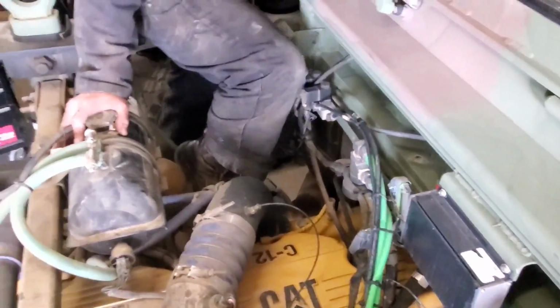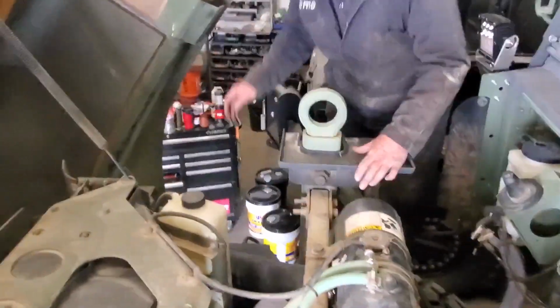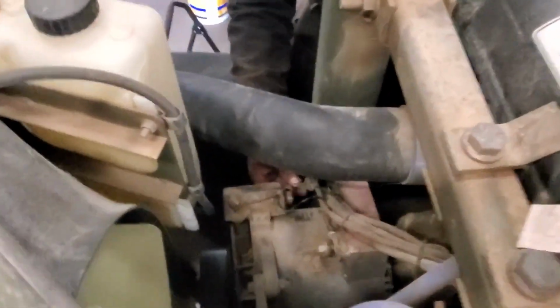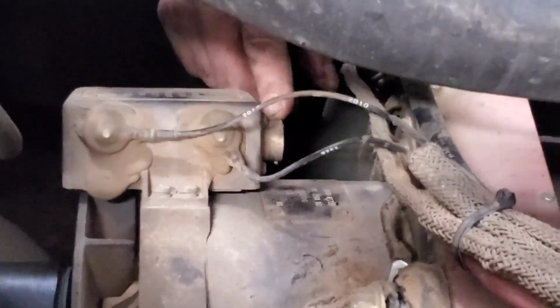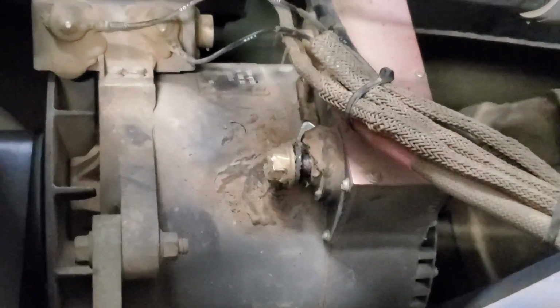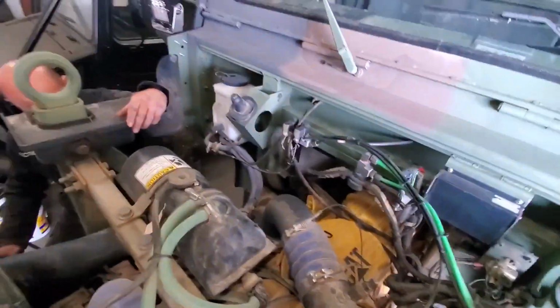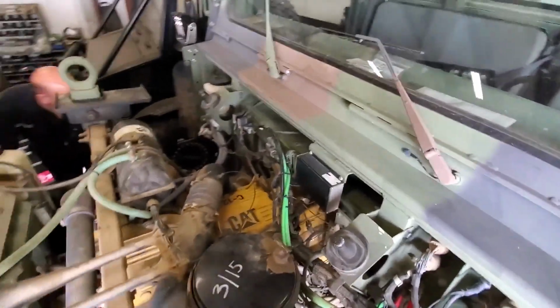Do we go back downstairs, or is that the last of them? Then we go over to the alternator. There are 2 Cannon connectors for your regulator. Disconnect them and remove the positive output cable. Got it. All right, and is that the last? That is it. So thank you, Oshkosh, for making what should be such an easy job.